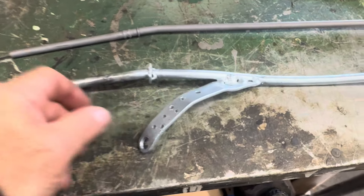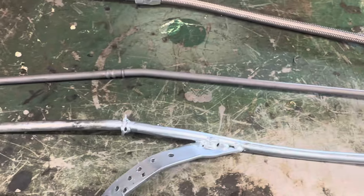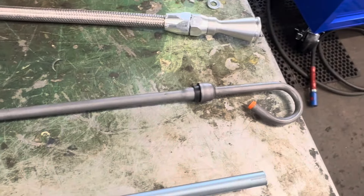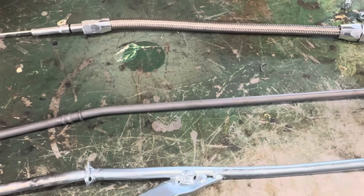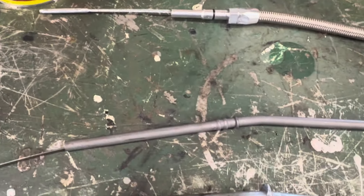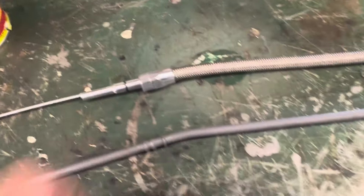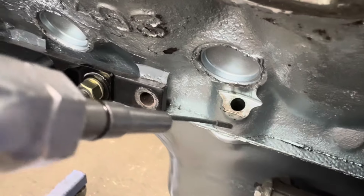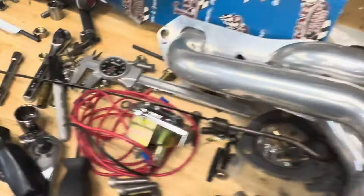So here's the dipstick tube going in the Firebird. This is a reproduction you can buy — I think it's Thorntons, the guys who make headers. They make these things and they're nice, like 30 to 35 bucks, and you can get the stick too. There's also an LS motor dipstick tube — I read years ago it was real close to the Oldsmobile. It does actually fit in the block but you have to grind it to clear. That big nut and tube end doesn't clear the block — you can see right there it hits where the freeze plug is. I didn't use it because it's plastic tubing with braided steel around it, and jammed between the header tubes it's going to get hot and melt.